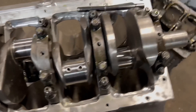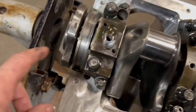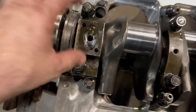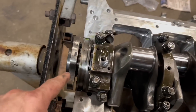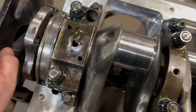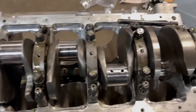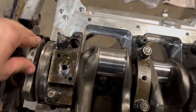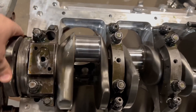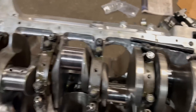We'll final torque these and then we're good to go. When putting the cap on, I put a dab of silicone on both sides of the cap and on the rear main seal area, then offset it just a little bit when I popped it down. That way it should seal up back there — a leak back there is always a problem once it's in the car. Thrust is about 10 thousandths, which is about where I like it. I've got everything lubed up with Lucas, so it won't move by hand easily, but once it gets regular oil in it this thing will spin super easy with no drag at all.